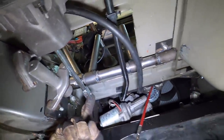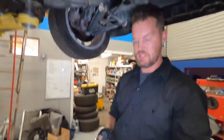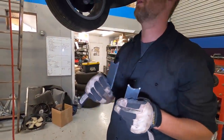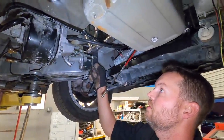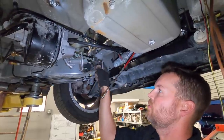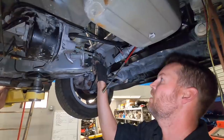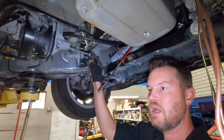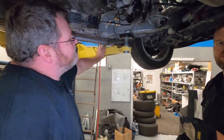And the brake, as you can see here, we had to have it line up with the booster actuator rod. Now what we're doing is I cut these 3/16 plates and coped them. And that's gonna go like that. But now we have to figure out how much. I mean, that one feels good, but there's a little bit of movement there. So like Laz just said, we have to bleed it. I have to open the valve and let the hydraulic pressure out. Yeah. See how much throw it has.